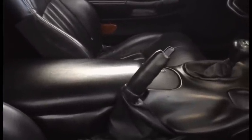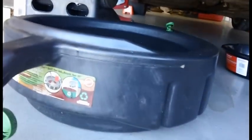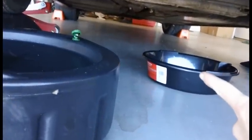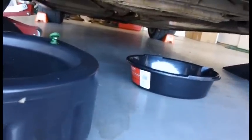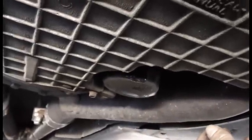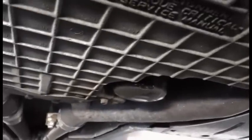I do every little thing I can to make sure it's going to be okay. Typically I use this big catch pan for the oil — it works really well. Today I'm recycling the oil; it's not used up in my Corvette, I'm going to put it in my daily driver. If we get underneath here I'll show you the oil pan. The first thing I'll do is take off the drain plug — takes a 15 millimeter socket — and then there's the oil filter in the back, which you can simply undo by hand many times. If not, you might need a special wrench, but typically I just grunt and groan until I get it off by hand. If a shop put them on, they always over-tighten and mess things up.